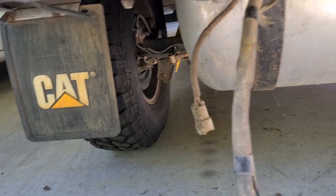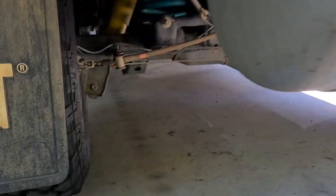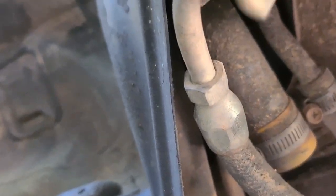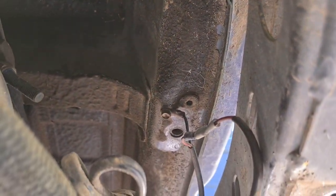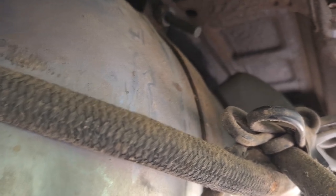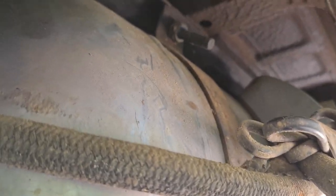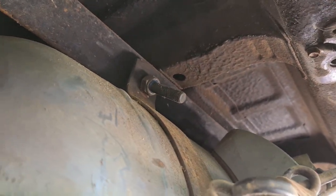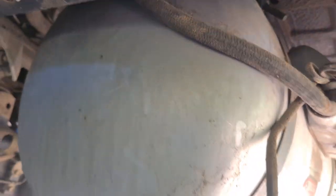After taking the tow bar off I found there was just a loose plug plugging into all this mess here. I unrouted some cable to get it out of the way. The filler tube piece literally just mounts up into a little gas tap just there that I'll need to undo. There's a ground cable for the whole system I need to undo, and then up there there's a bolt that appears to hold the strap in. This will be a deep socket job — I might need ring spanners. It could be heavy so I'll find something to support it.